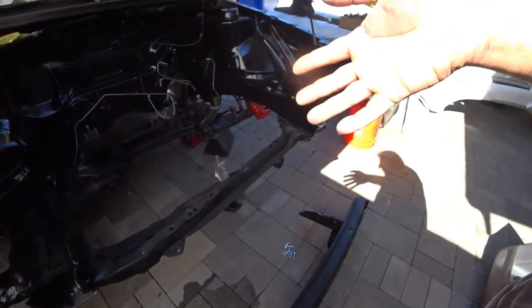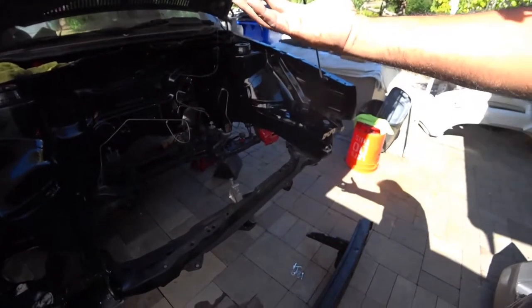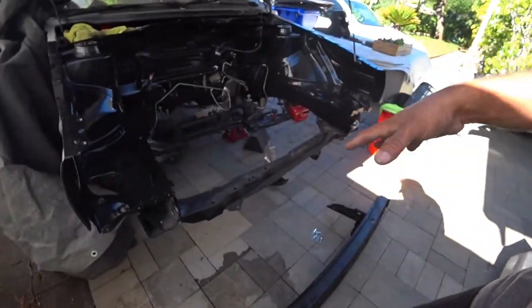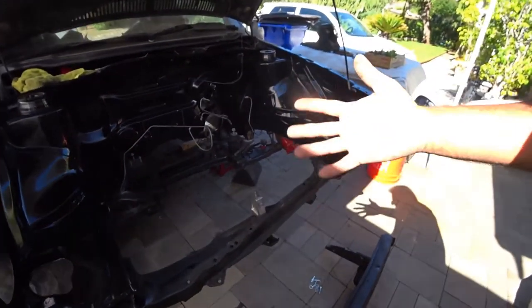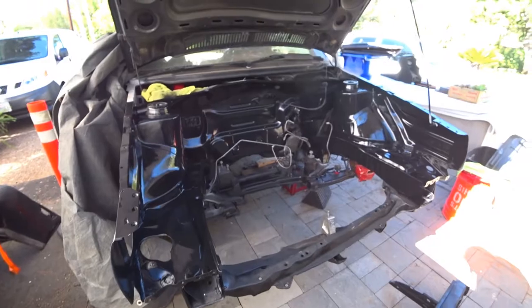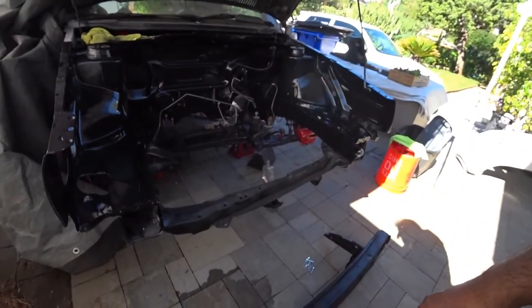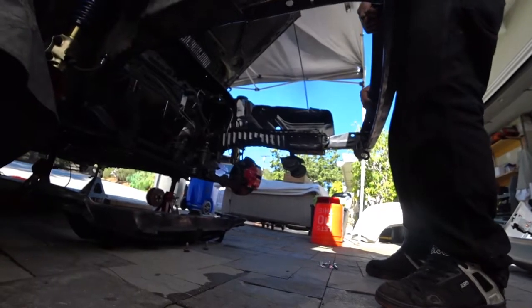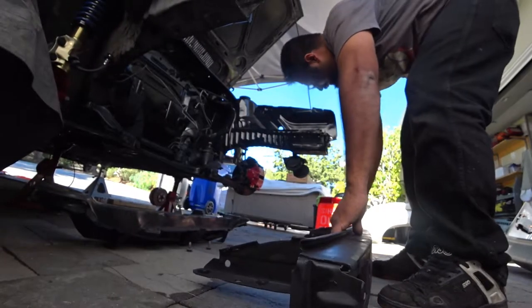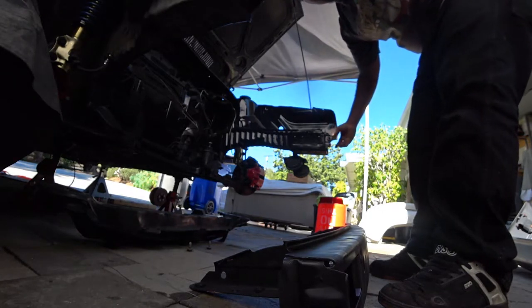My recommendation: install your motor first, then mount this bar. Do not try to put your engine in while this is already installed — you won't have enough space and you can damage your paint. That's really vital especially if you did a shave bay. Next we're going to install the front beam. Oh, and there are two bolts here you need to take out as well.